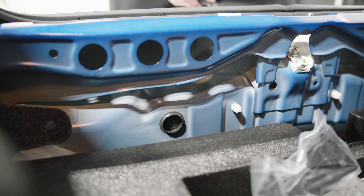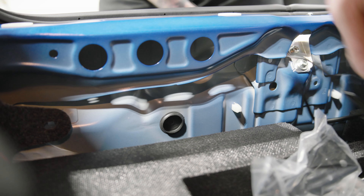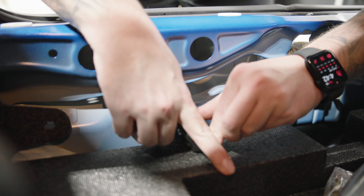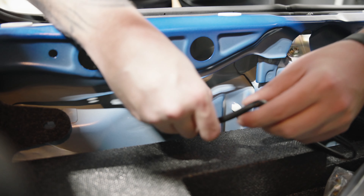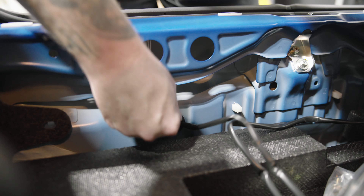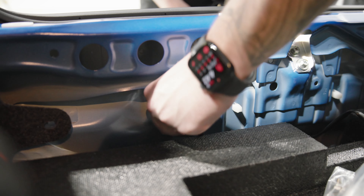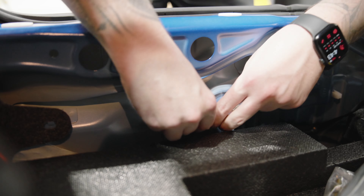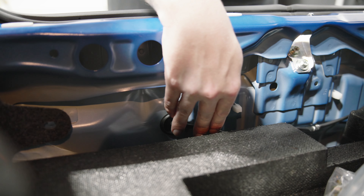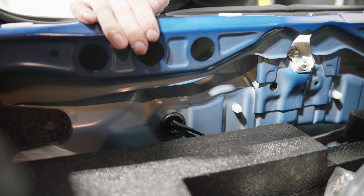What we're going to do next, grab a simple punch tool or even a box cutter, and we're basically going to make just a small hole — no bigger than the head of this connector. That'll allow us to run the actual brake light wire all the way down. A punch tool actually works perfectly so that you still get a good seal — you don't want any exhaust fumes coming up into the trunk. Then you'll basically feed this down into the lower portion of the bumper, leaving enough slack so that when you pull it tight on the taillight side it can run straight down and across like an L. That should allow enough clearance to put back the trunk trim.